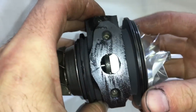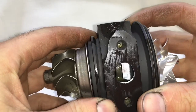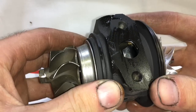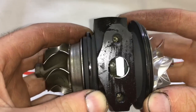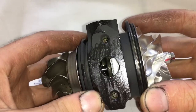Here's our revised oil deflector on the TD03 — this is a setup I already rebuilt. You can see how it doesn't cover up as much of the drain area; it's cut back so it helps prevent oil from getting backed up in the cartridge and being forced out the seals.